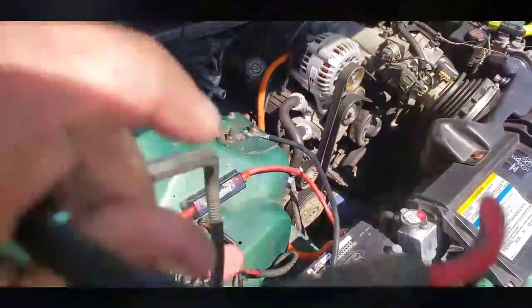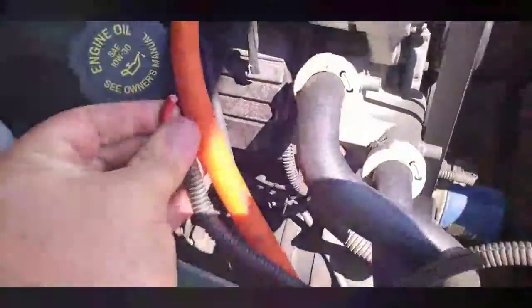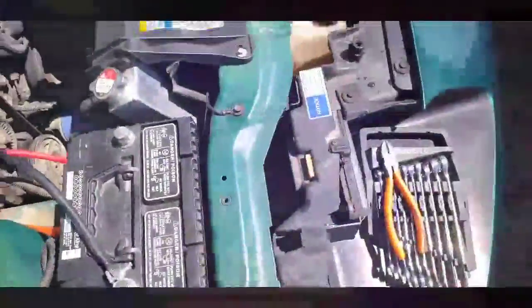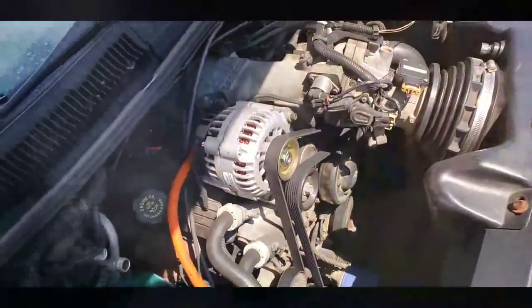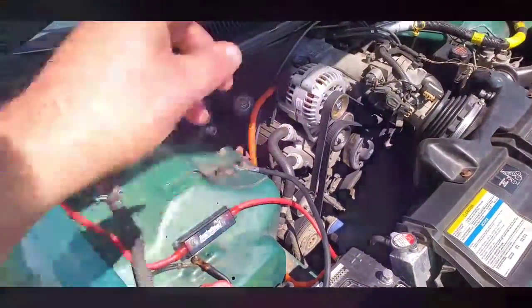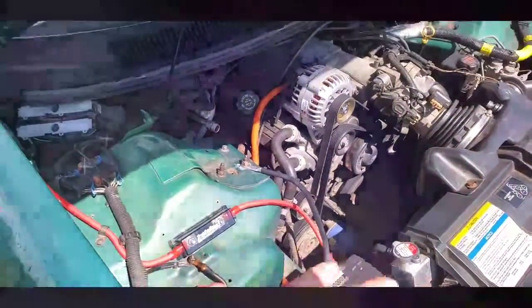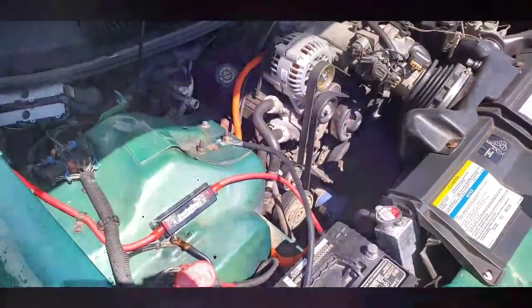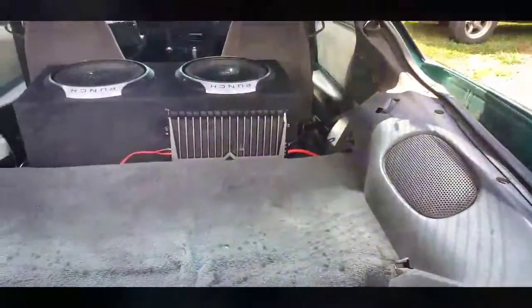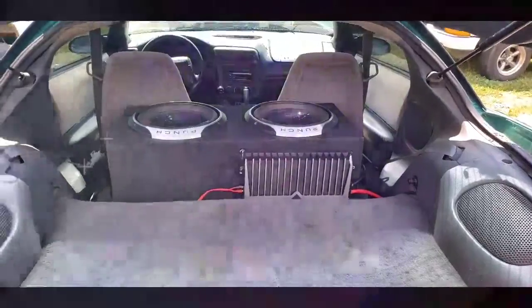Here's what we took off — just a tiny wire. Yeah, that's a big difference. The alternator is just a factory replacement, but this is going to help. We also need to do that ground block, and then we'll have this stuff as good as it can be at the moment, without upgrading the alternator and stuff like that, which we don't need to do. We're not pushing a whole lot of power obviously.